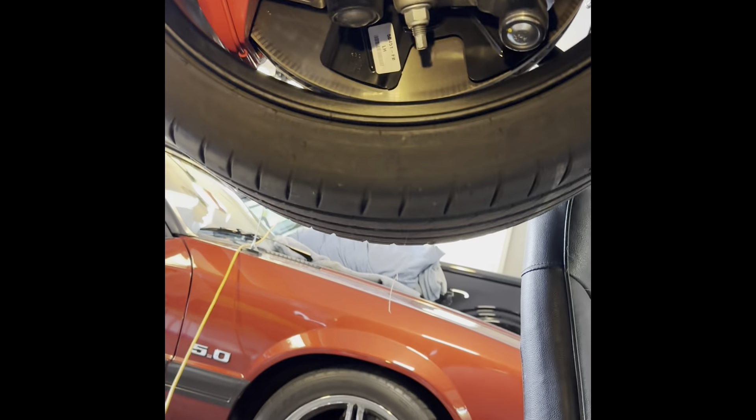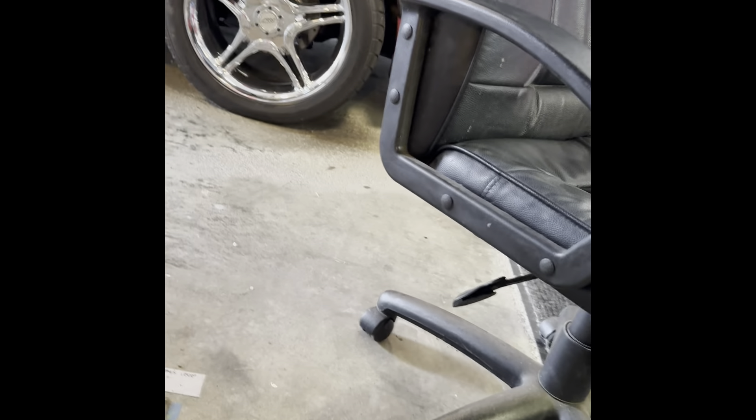Now all the oil is draining. We're going to start getting the oil filter housing ready — you do need a little Torx head. It's already loosened up. Drop this little trap door down — that just comes out just like that. Slot that over there so we don't lose it. It's really difficult because I didn't start it and let it run. I'm hoping all the oil has settled so I'll make less of a mess, because the last couple of times I've changed oil I've tried to put up some little deflection devices so when I pop that canister off it doesn't drip all over the place. I'll throw some towels and old rags in there and we'll get that process going.